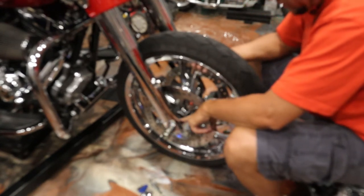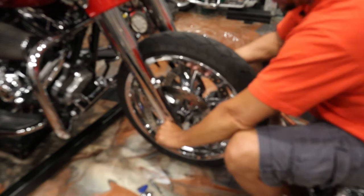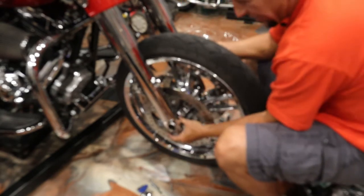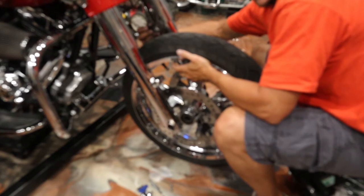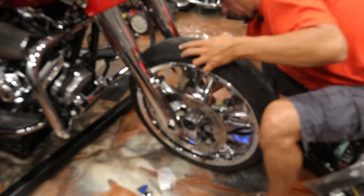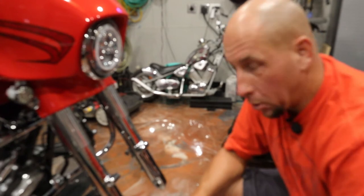Kind of grab a hold of the wheel. There's a wheel spacer in here with grooves - when it gets put back on it goes to the outside. Lift that up and it didn't drop out - there's your ABS sensor that kind of drops out the other side too. Basically the spacer and a sensor, and there's the clip that fell off. Wheel the wheel out of the way. If you get mixed up which side is which just look at your tire to see which way it rotates. Sometimes I'll put a little piece of tape on there to mark the ABS bearing side.